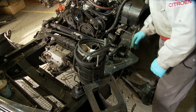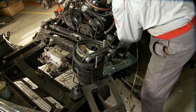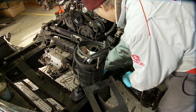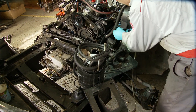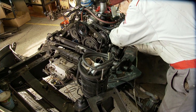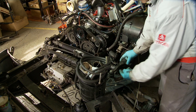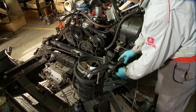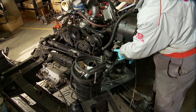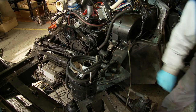Now I can get to the steering rack, but first we have some wires — these will be the reversing light wires, which disconnect easily. There's also the speedo cable, which undoes with a knurled nut. Moving on to the steering rack — we've got the steering arm held on with a bolt, which gives access to the clamp bolts holding the rack in place. We also have to move the steering column out of the way and take off the hydraulic feed pipe union on both sides.